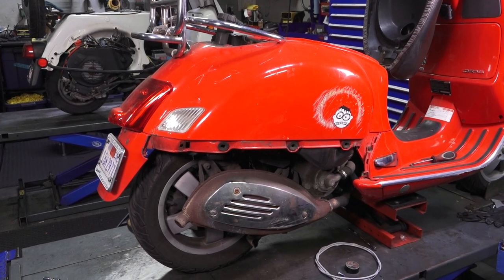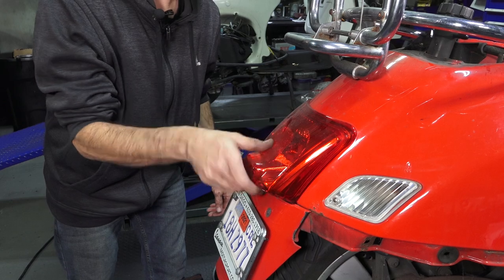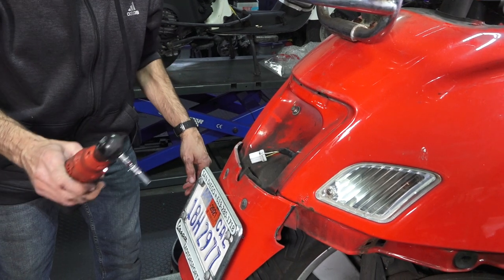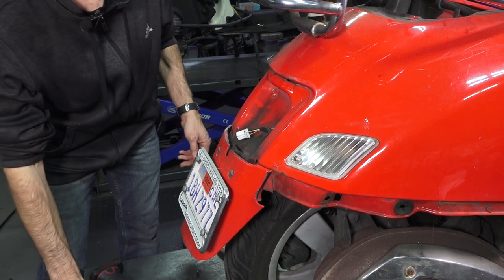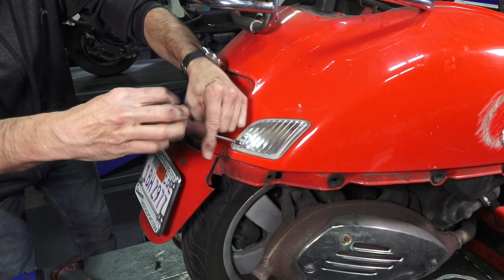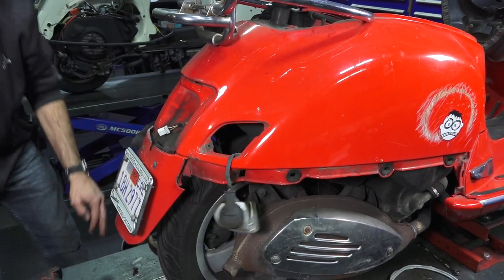Now you can see part of the fuel tank and wonder how it comes down with the motor in the way — we're getting there. On the rear, remove the tail light because there's a hidden fastener under there specific to holding the fuel tank — eight-millimeter driver, with a flat washer and split washer. Also take off the pair of turn signals before you leave the rear, because the fuel tank will hit them. Just pop them out and hang them from the wires.